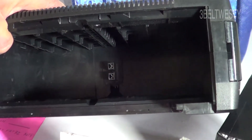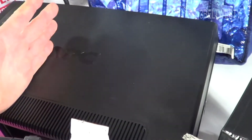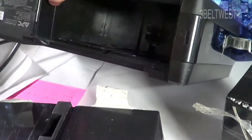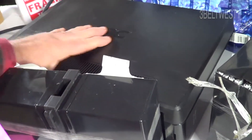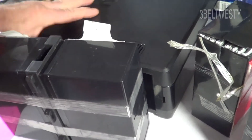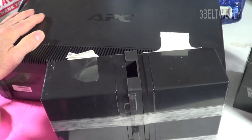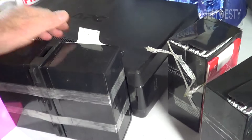I had a little 12-volt UPS in the past, about half this size — about the size of the scanner over here — and I had it hooked up to a big trolling motor battery. It actually boiled the heck out of a big battery, about a group 27 form factor, boiled it completely out. So I had a fuse hooked up in a 12-volt unit connected to a deep-discharge battery. If you do that it gives many hours of backup, but it tends to boil the cell out. So you need to check the water once a month to make sure you don't boil out the cell.